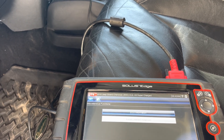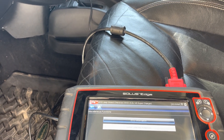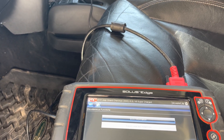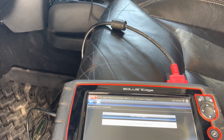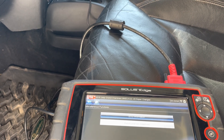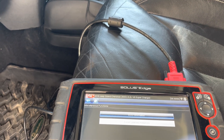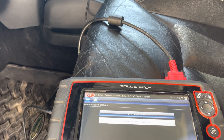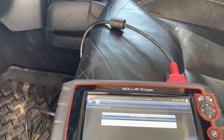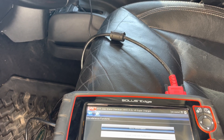This is the procedure I go through before driving these. Get everything prepped — make sure the transmission has at least eight to nine quarts. When you pull the pan and flash the valve body and put it all together, generally eight to nine quarts. Get it running — when you do the fluid it has to be running. In park, running, pull the plug, add the fluid in the side. Start off with four quarts, then get it running and add another four to five quarts, get it all topped off and ready to go. Then go through this procedure by clearing out the computer, getting everything fresh and starting over.